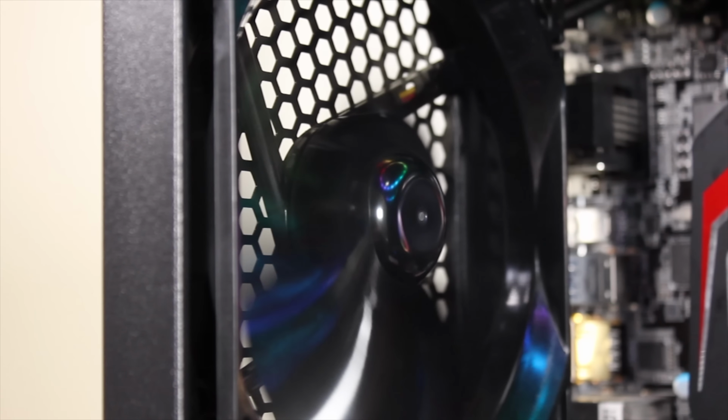And then it also has a bracket as well, which has got 2 screws. You pull that off, and then you can use a long screwdriver that's quite thin, and then undo the PCI bracket. Then we've got a nice opening out for the actual power supply unit right there. But let's talk about inside the actual case itself.